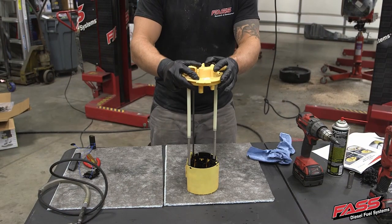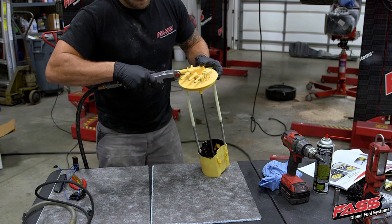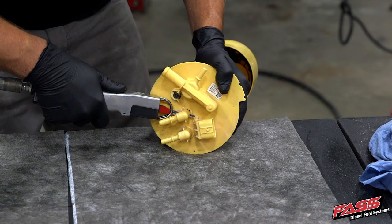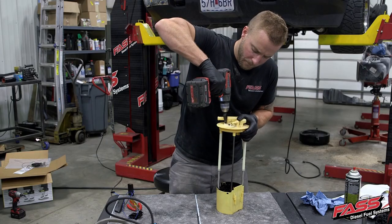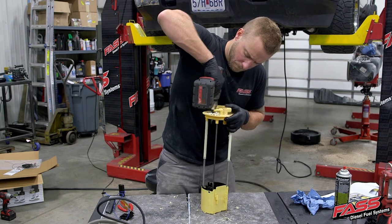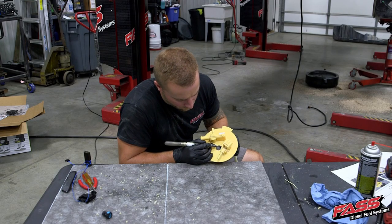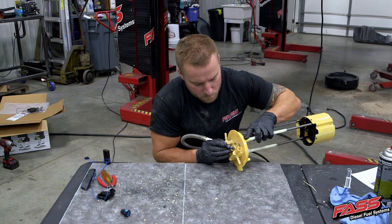Reassemble the upper and lower sections of the fuel tank module. Using an air saw or equivalent, cut the two sections of the fuel tank module off as shown. Using a 7/8-inch hole saw or step drill bit, drill the center holes of the two fittings that were just cut off. Using a pencil grinder, carefully clearance the top side and the bottom side of the fuel tank module as necessary to create enough clearance for BHF-1005.